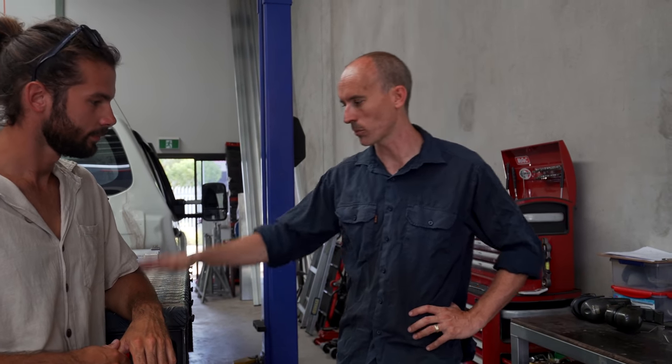Cool. And I suppose obviously a few more pros that come with doing a chassis extension. There's loads. Probably your biggest one is your safety that you were talking about. Yep. There's like the comfort of driving them. You retain, or you get your braking back. Obviously a lot of guys will put a big heavy weight here or a spare wheel hanging off the back, caravan hanging off the back, it all unloads the front of the car. Yep. So you end up with wishy-washy steering, average brakes. If you move those rear wheels back, you get them under the load, pushes a lot more of the weight further forward again, and it rebalances that front axle. So you've got the weight there, your braking and your steering's all good.